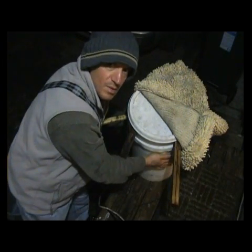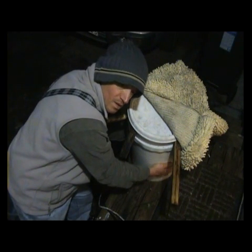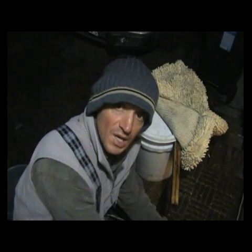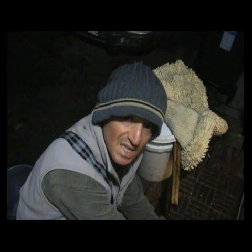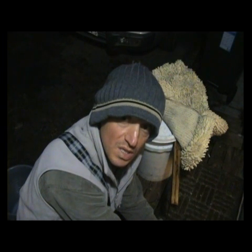I'm touching the sides of it and it's pretty hot now — nice and hot. I'm going to pull the plug out. Never ever ever lift the element out of the oil with the plug joined. That is very dangerous.